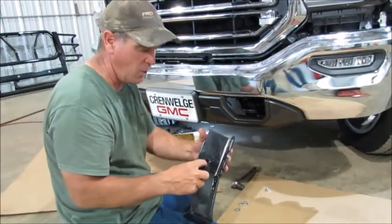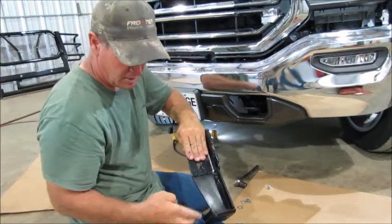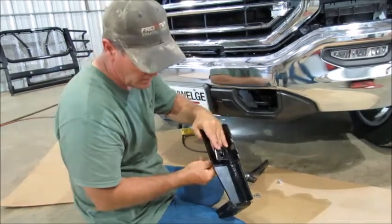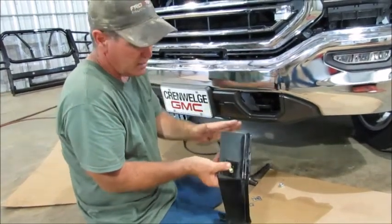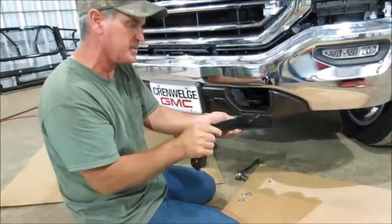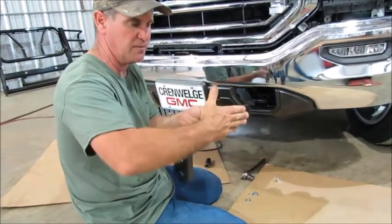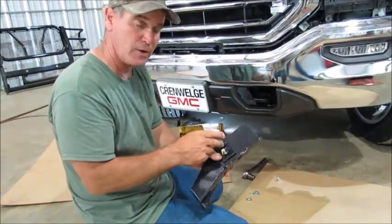This hole right here does not have a hole in the frame. All that is is that your frame comes right to the edge. This little square tab right here is going to go on top of your frame. When you tighten that bolt — with the bolt provided, half by one and three quarters — it goes in there and you tighten that. It pinches the frame in between those two. There's a cup on the bottom of the frame that's really hard to see here, but you'll see it because it bottoms out — the bracket stops on it and wedges in that cup. Once that's tightened in there, that bracket cannot rock back and forth. All that side bolt has to do is keep it flat against the side of the frame. It's very strong once all that's in there, but you have to put that pinch bolt in or it will not be strong at all.